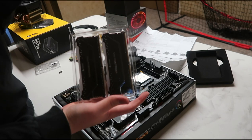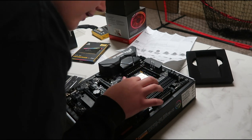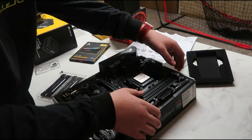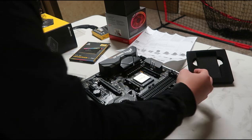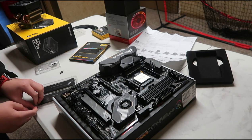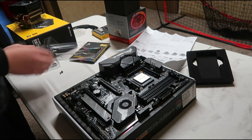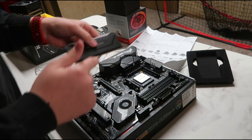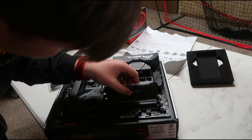Here we have our sticks of memory. You have to look at your own motherboard because it might have differences. For this one, there's a star — it says B1, B2, A1, A2, with a star between B2 and A2, so I know I have to put it in the gray ones. Open these up. These over here are still and not moving, so you only open up one side. Some motherboards you do have to open up both. You have to pay attention to the little notch, line it up, and make sure you're not sticking them in the wrong slots.